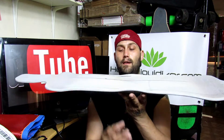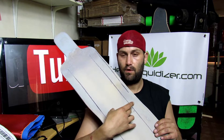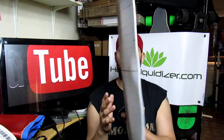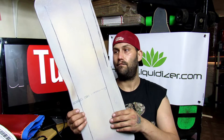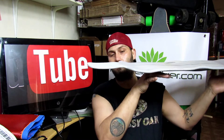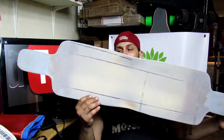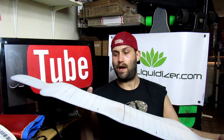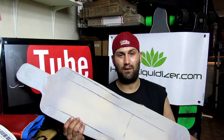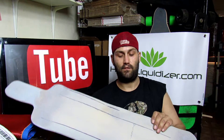Here's the core. I've shaped it out — I just haven't cut the hole in the center yet. That piece we cut out will actually be used for the bottom part. I put my concave in it and a couple extra dips. The concave does make it slightly drop-down, which I think is perfect. If you've seen surfboards being built, it's almost the same exact thing on a smaller scale — shaping, getting your corners, all that. The difference is you're heating this with a heat gun and bending it.